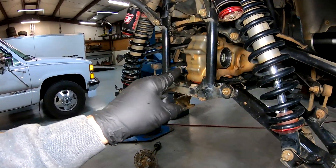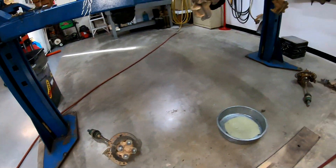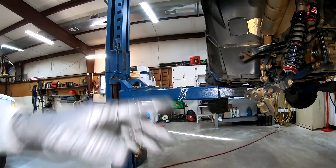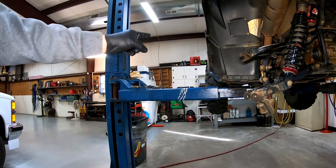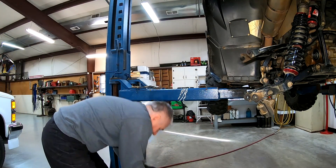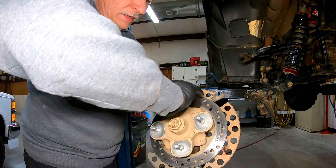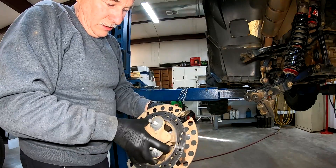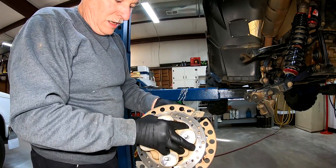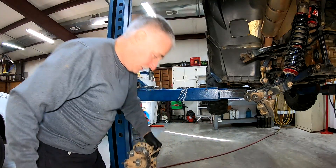Put the plug back in, we'll fill it back up after we stick our axles in. But let me show you something else I found. Remember I was telling you about the left front wheel bearing making noise when I spun the wheel? Well, same thing back here. Hear that? Noisy. They're not loose — usually the Polaris guys notice their wheel bearings are shot because they get loose, but there's no play in them, they're just noisy. So they've gotten rough over the years.